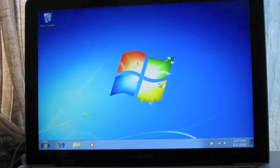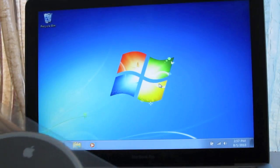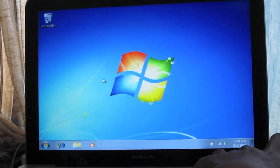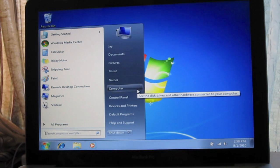The next thing you want to do is not update using Windows Update yet. You want to use your MacBook Pro install DVD and pop that in. It will install the drivers you'll need. You'll notice that if you press the eject button on your Mac keyboard, it won't pop out the Windows installation disk, so go to Computer, right-click the DVD, and go to Eject.